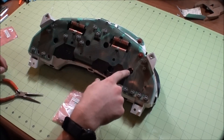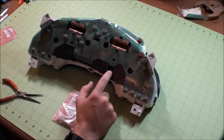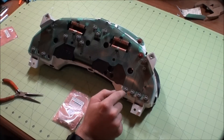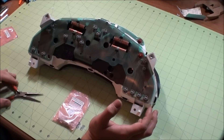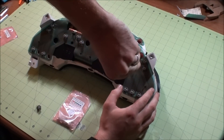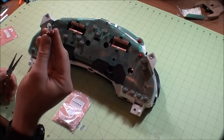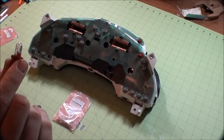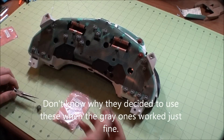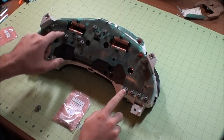I am going to be replacing mainly the backlight ones, the theater lights, and the odometer one — because on the previous night video, the light wasn't on. I switched out with ABS; I don't have ABS, so I just switched the bulbs out. What you're going to want to do is go back to the junkyard when replacing these backlight ones. It may be different depending on the year of your Saturn or vehicle, but you want to replace these red ones. These right here, you cannot remove the bulb — or if you do figure out how, you're going to have to do a lot of wiring and soldering. So what you're going to do is replace them with the gray ones that you can find in any Saturn — just pull out the instrument clusters and liberate these things from the cluster itself.